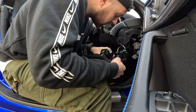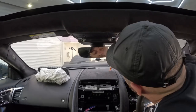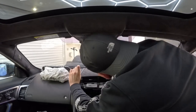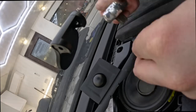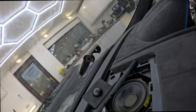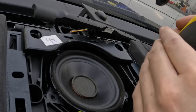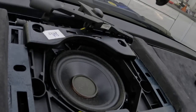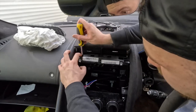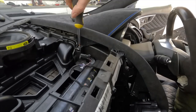Part of the infotainment system is removed and also the trim beneath the steering wheel. The next thing is the centre vent, which comes out of the dash — it's quite a common thing for these to fail. I'm going to have a look at this while it's off the car and see if I can repair the system which makes it come up and down. The first thing that comes off is the speaker trim, which then reveals T20 screws holding in the speaker and the trim too. Some of these were a little bit concealed, so I needed a longer screwdriver with a T20 bit to get down to them. Once those were out, I could unplug the heater vents and get the vent off the car.